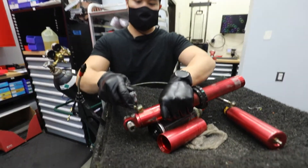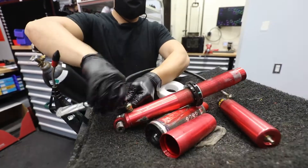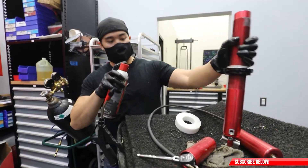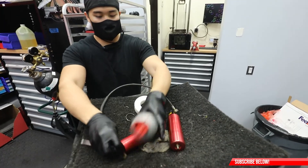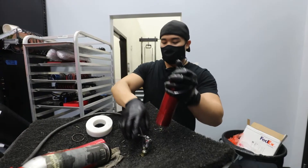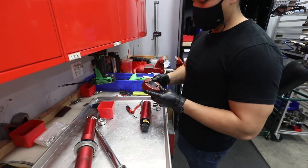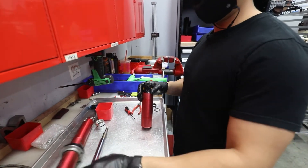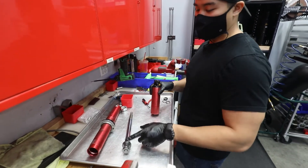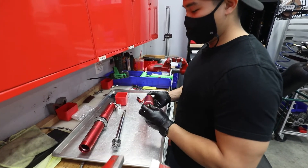Let me just pop the swivel. Now let's clean out some oil so that our ultrasonic cleaner doesn't get a bunch of oil in it. And then I'm going to crack the other swivel on the canister. Now we're going to break down the canister using our aluminum body clamp so we don't mar any of the anodizing on the canister. When we bring life to these really old, prehistoric shocks, we're going to be keeping the canisters and the piston rod. The valving and stuff is going to go along with it, but we're going to change the piston so they can match the new diameter of the new shock bodies.